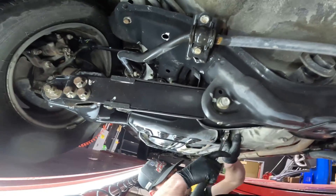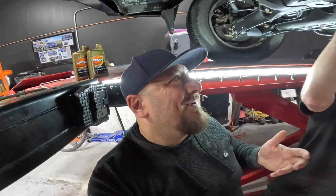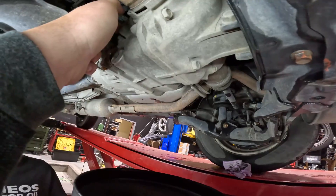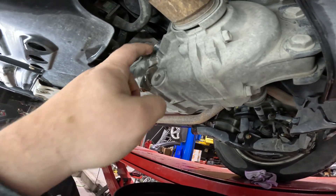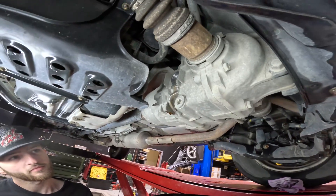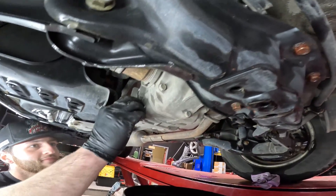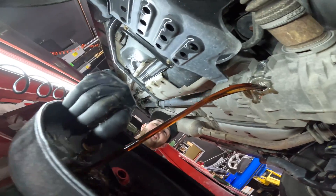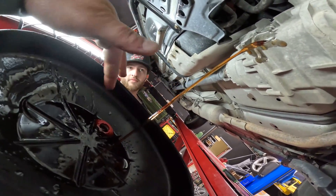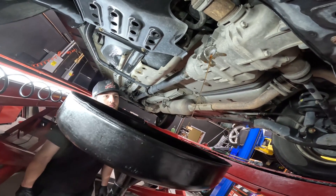It's wild how good a condition the CR-V is with 318,000 miles. Walker is a drifter — he has an '86 Toyota, but his daily is this awesome CR-V. We can see it's pouring out. The factory service manual tells us that if the fluid is to the top or bottom of the fill plug, we know it's full. It's pretty clean — actually not that bad. Walker mentioned he had done it at some point, which is good. One key issue with DPSF is that as it nears its end of life cycle, it can cause chattering while cornering. It's not so much that it gets dirty, but if periodical fluid changes aren't performed, it can cause much larger components to fail.